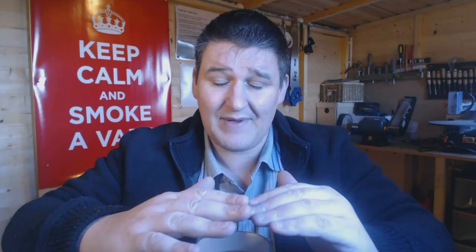Your plating or paint on a mod is only microns thick. It really is thin. So if you go in at it with a hard abrasive polish or try sanding it, you'll just eat right through that plating and go down to whatever is underneath the plating or paint.